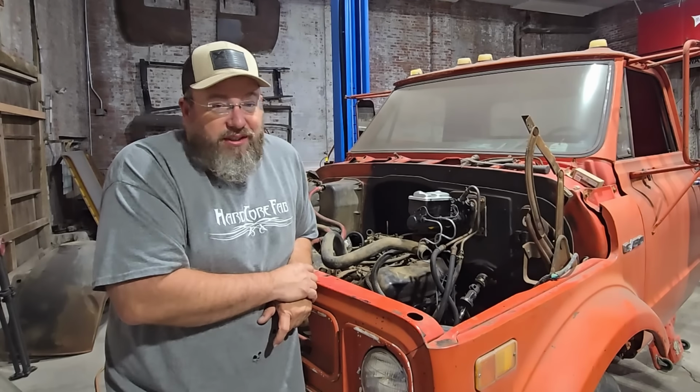So I ended up taking this over to my friend Aaron King at King Precision here in Hutchinson, Kansas. And he was able to take another piece of an old radiator and patch in our hole from the spout that was on the back, and then put us a new mount for our cap. So now it looks like an original style radiator you see in most C10 trucks or C50 trucks or whatever. So now I think this should drop right down here into place and be where we can hook it up.